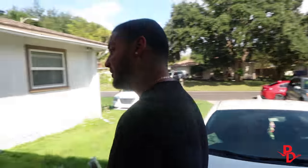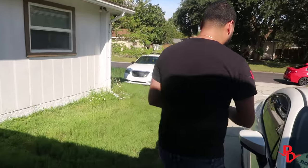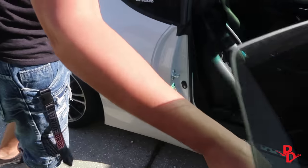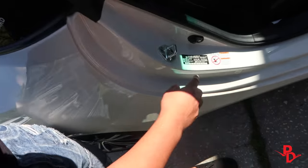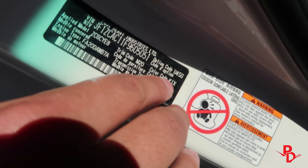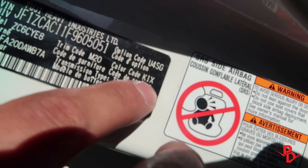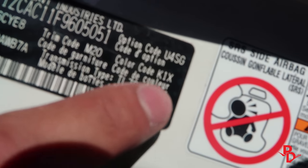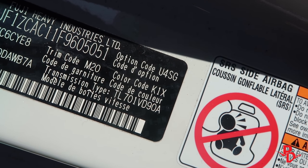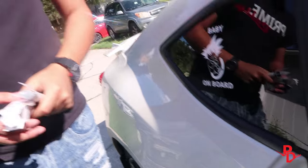Because there are a lot of shades of white out there. Every car has that. I found mine right here on the VIN tab where the VIN number is. It says color code right there — K1X. Of course, every car has its own color code, but before you get some paint, make sure you get the right one for you, because you don't want to end up with a different shade of whatever color your car is.